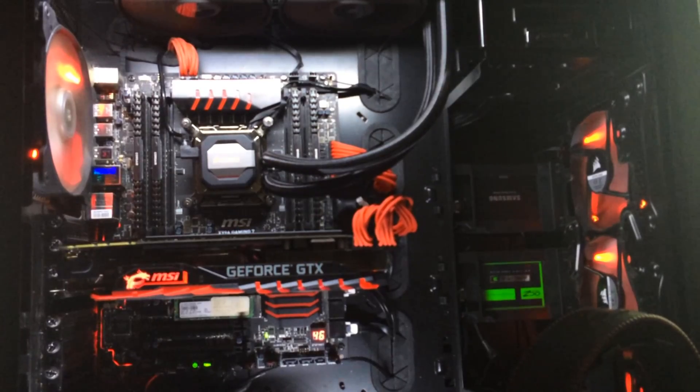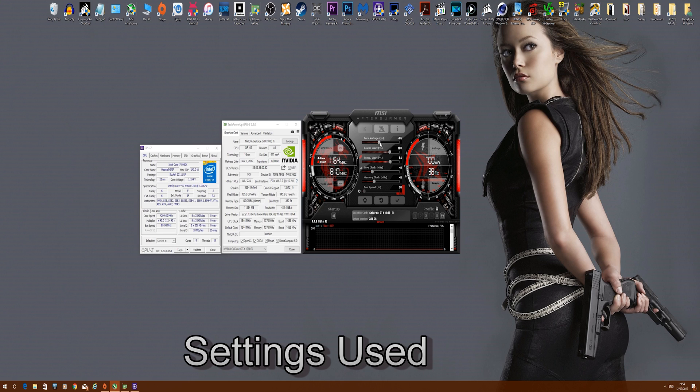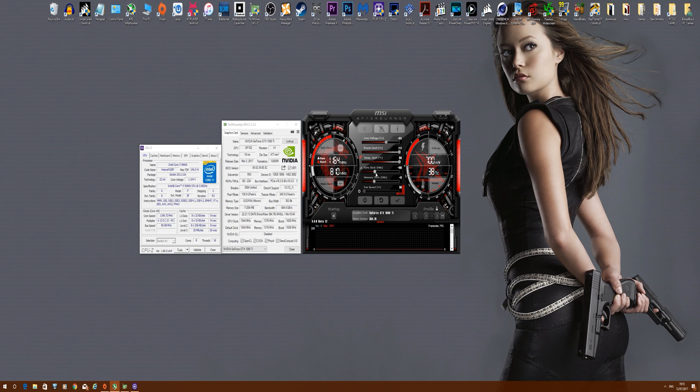So what I'm going to do now is put the card through its paces. Here are the overclock settings I want to be using for the test: 65 on the voltage, power limit up to 117 percent, temperature limit also at the maximum which is 90. Core clock I can only get a maximum of around 87 to 90 out of it — I find 87 is the maximum stable clock for the most part — and memory I'm going to push up to 350. That's the most stable clocks I know for this card and this should push it close to its maximum.